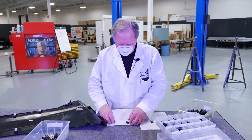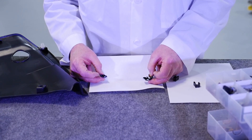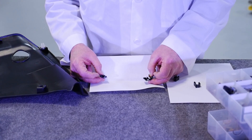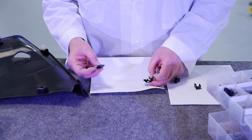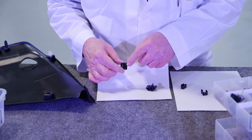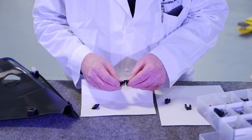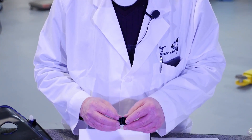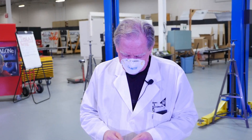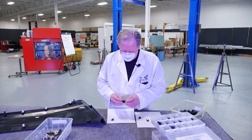So let's look at the part that broke. This right here — if you can zoom in as tight as you can — this is the part that failed inside the driver's side fender. We look at it and we see that this is going to be very difficult to see, but right here is the joining point. And you can see that that joining point is very, very fragile. It's got almost no land left. The land is also undercut, which means that it's going to be a stress riser. So this isn't really something that I would classify as robust enough to take the assembly process — it's very, very complicated.